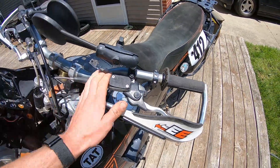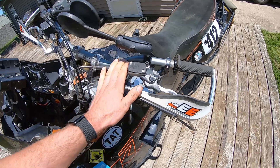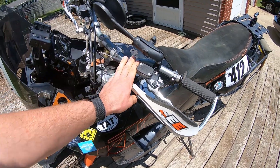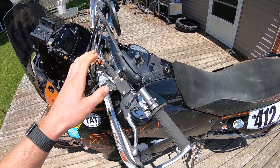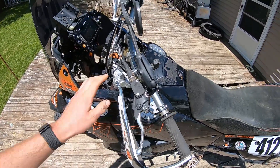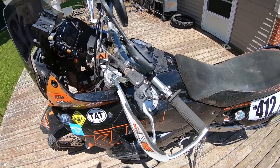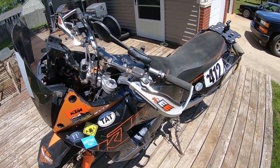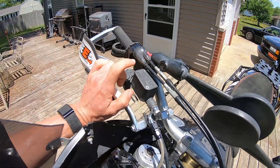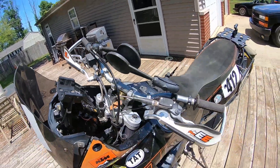The last remaining trick up here is that I've converted this away from the Magura parts. It now uses a more modern Brembo master cylinder along with an Oberon clutch slave, so I can use brake fluid with it. This is a 9mm diameter clutch master, so it lightens the clutch quite a bit — very light and easy to use. That was a big improvement, and now I don't have to worry about the mineral oil issue if something happens on the road. The front brake uses a Super Enduro master cylinder, which is smaller than the stock adventure master so it works properly with the single brake caliper.